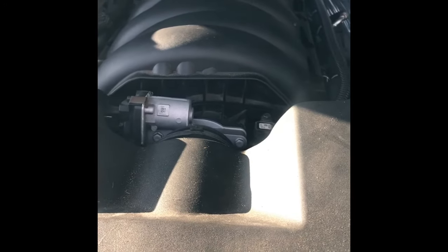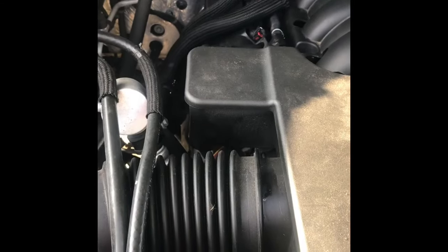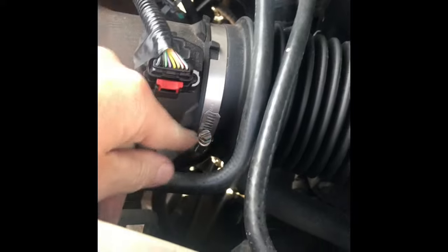What else? There's a couple things I mentioned in the video I think I had to correct myself on. Anyways, that's how it looks all assembled. So when you take this plenum piece out, you just loosen this, and then on the throttle body, same thing, loosen that screw right there, if you can see that. And then those two connectors on the left, this just pulls off, pull straight back and pull to the side on this one, and this whole piece lifts out.